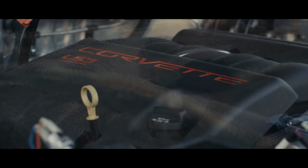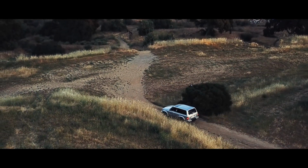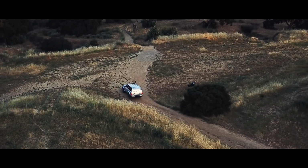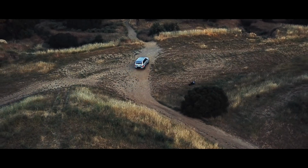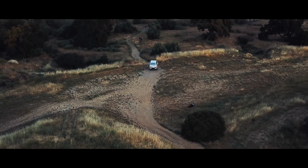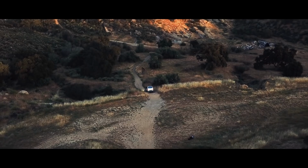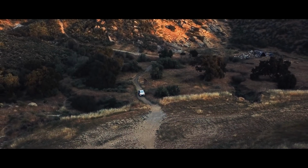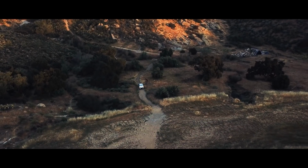So this truck is set up with still the stock full-time four-wheel drive transfer case, and that is a 2-speed. It has high and low. That has been completely rebuilt, and then we attached it to the General Motors 4L65E automatic with overdrive, which is getting all the juice from the approximate 430 horsepower LS3 6.2 General Motors emissions certified E-Rod aluminum fuel injected V8.